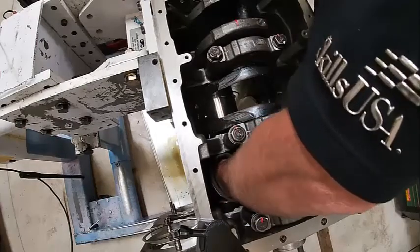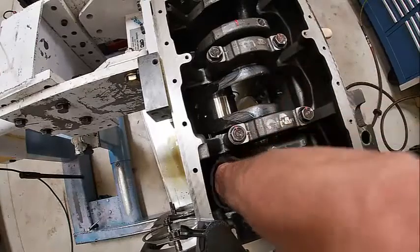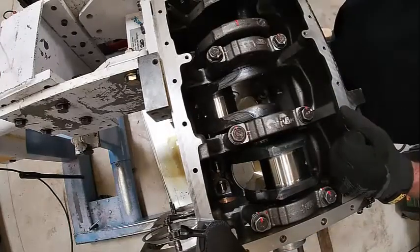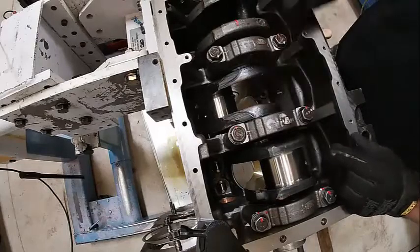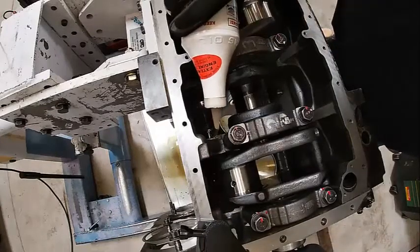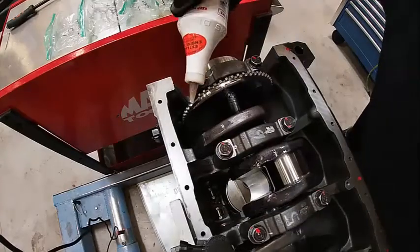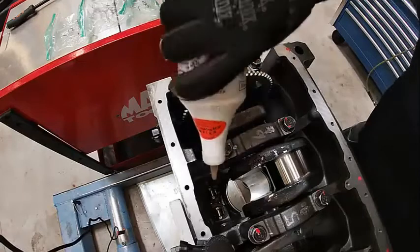If you had to do a camshaft in one of these, what you have to do to get the camshaft out is have the engine either inverted on a stand like we are, or they have a certain size dowel rod that goes into that lifter and holds it up. I'll roll the engine up on the front — that'll make sure they stay down after I pour some oil in there. We'll dump some oil on them, make sure there's plenty of lube there, getting some on the cam too. Engine assembly lube works a little better sometimes because it's more sticky. This has some Lucas oil which is thicker in it.